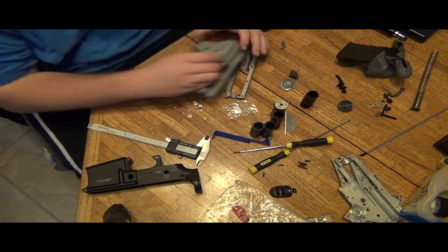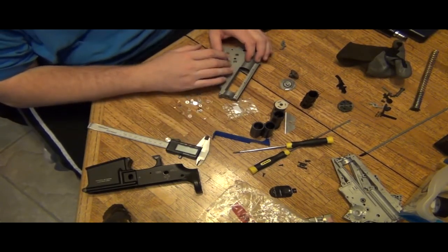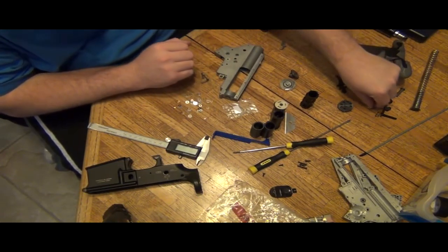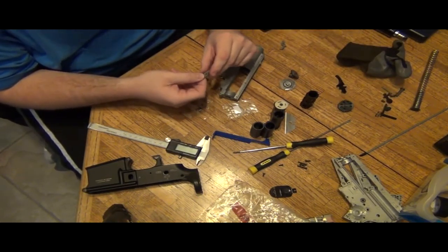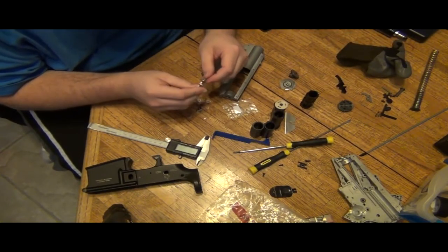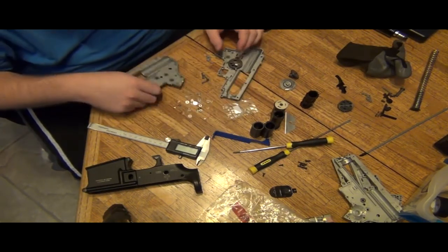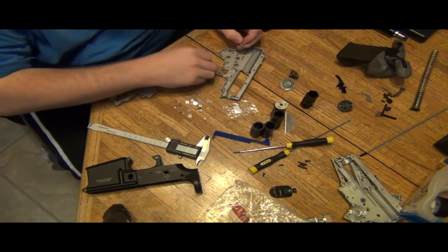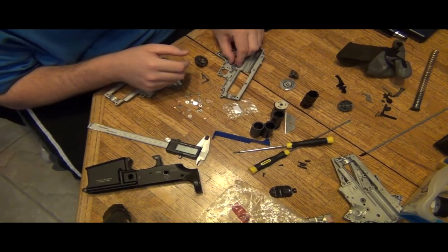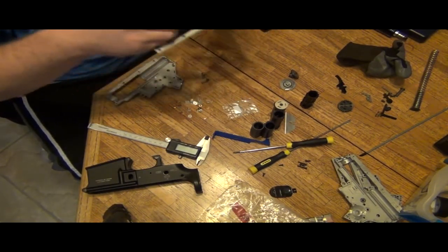So now we're going to go ahead, and you don't need to know that really if your gear is different, because your gear is going to take different shims on the bottom and top. But you saw how I was avoiding the cutoff. I went looking around and I found a better cutoff that's in good condition. I think this is a VFC cutoff, I'm not really sure. We're going to go ahead and pull this off. Keep all the shims on the gear, even the one on the bottom. And I'm going to put this down in here and see if I need to move some of my shims to cover the bottom.